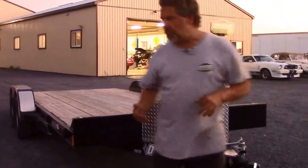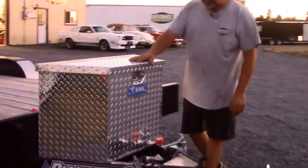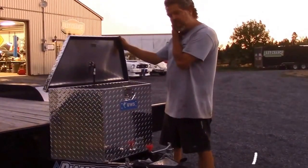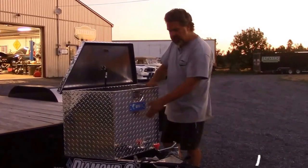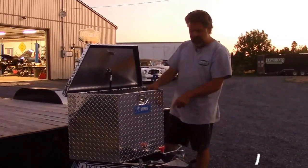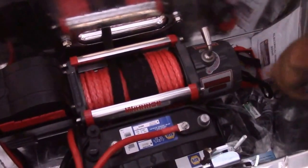With his classic vehicle, what we've done is we've purchased this enclosure — it's a polished checker plate. This originally had just an open tongue and no reinforcement underneath. We purchased this from our NAPA supplier; it's a really nice high-polished checker plate. Before we installed this box, we added three reinforcement bars and welded it structurally in place. We added some rust inhibitor paint to protect the steel, drilled holes, and as you come closer into the box, you'll see we have a Warrior brand winch.